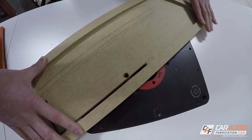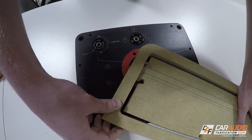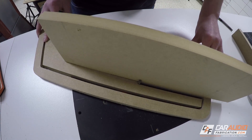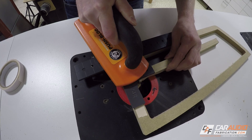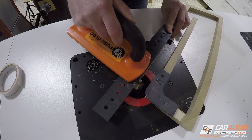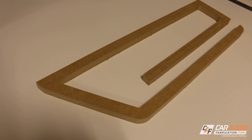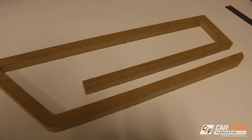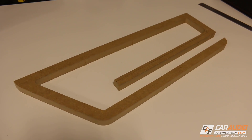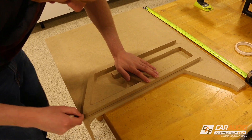To make the shape for this first piece I had to combine a couple of different profiles. I started with the outside shape, then used a straight edge to make the actual port wall itself. I then used a Mobile Solutions radius template to round some of the corners, and finally cut out the end of the port using the templates as well. This is quite time consuming, but it's going to pay off — since this is the first layer, we want to make sure it's perfect so we can continue to copy it into the next layer.